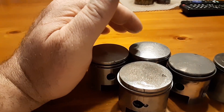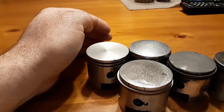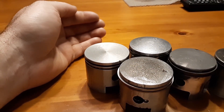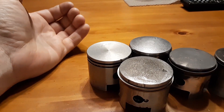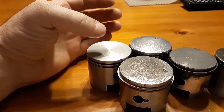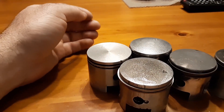The problem is the moped never runs at 10,000 RPM non-stop because it has a transmission. After about 50 seconds, the piston starts heating up more than the cast iron and you get a cold seize. In the saw case, the guy ran 50 to 1 with the original plug running it really hot and long — same result. You want to run 40 to 1 or 32 to 1 even in those builds just to cover all the ground.